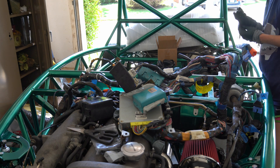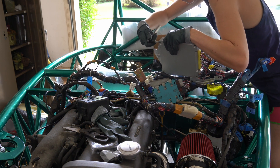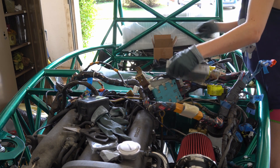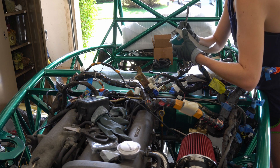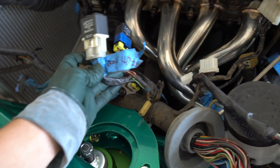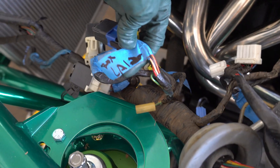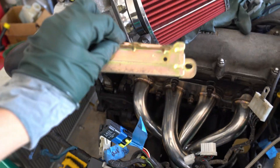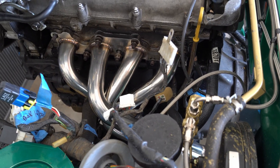It feels like a lot of steps just to get a small space. I went about trying to remove some brackets to clear up room to get all components within the wiring tray. You'll see me trying to pull off the brackets on the blue components — just unplug those unless you plan to run an airbag. I couldn't figure out what these labels said — something like 'box HD headlight' something, and then it was box LA12. It had been plugged into something else, a bit of a wild goose chase, but those connected to this golden boy. A few connectors have multiple matches on a first-generation Miata, so be wary of that. Mystery solved.